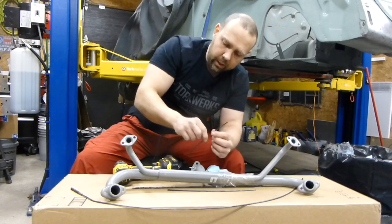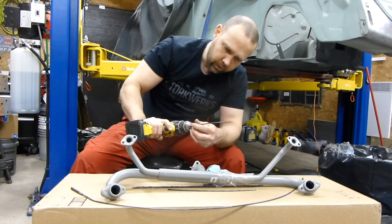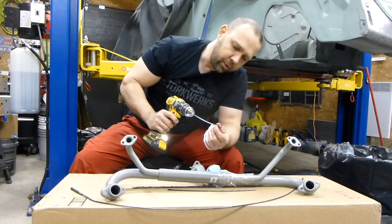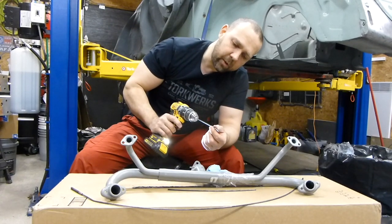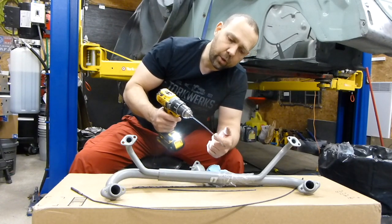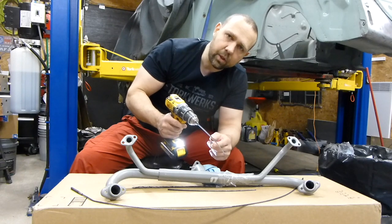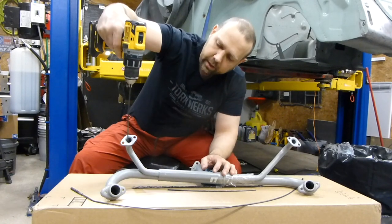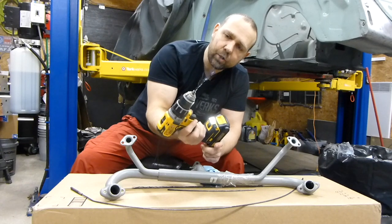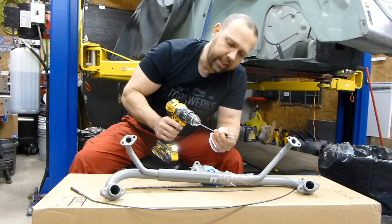What I do is use a drill — put one end into the drill, tighten it down, and then spin it. When you spin it, you want to make sure that you're spinning the cable in the direction of the winding so that the cable doesn't undo itself as you're spinning through. If that's clockwise or counterclockwise, that's for you to determine. You ideally put it in clockwise so that the winding is also clockwise. Feed it into the intake as you go through — and that's what happens if you go in the wrong direction, so you want to be careful not to do that.